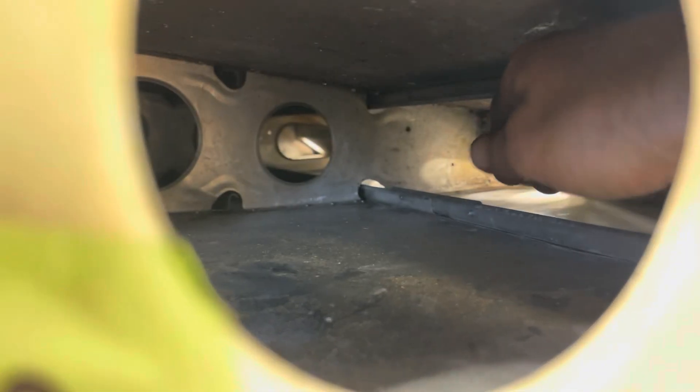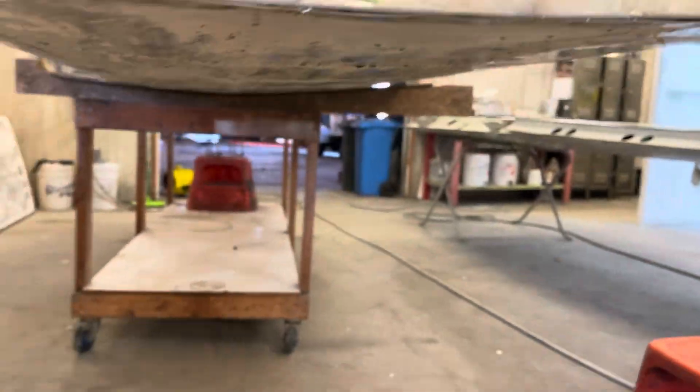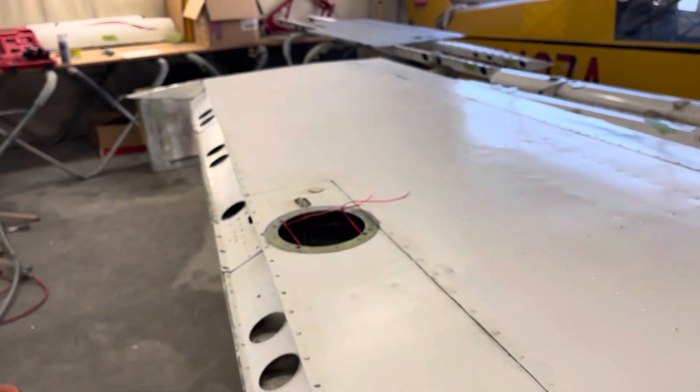As you can see, I had a fairly failed attempt at completely paint stripping the top surface of this wing, so I'll redo that after the bottom surface. I do find some interesting things in these aeroplanes — this one is 47 years old. The wing skin had a bit of a pop in it, and when I looked, this stringer has been repaired. We've only got one rivet there and one I can't quite reach. They've also missed a few rivets, which is why there's a little pop in the skin. That would have happened at some point in its 47-year life — but that's why we're giving it a birthday and fixing all those things.